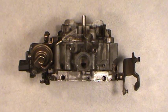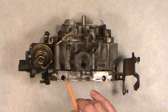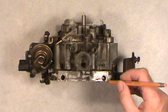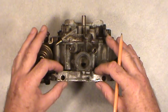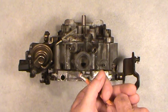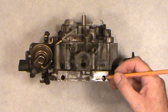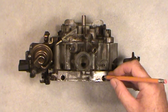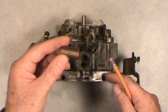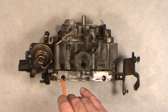So what I did is I got out my high-speed electric grinder, also known as a Dremel, and put a little grindstone on there. Like you see here, there are holes here now — these were solidly capped with the hardened steel plug I was telling you about. So I just took my time, put my safety glasses on, and went to it. I had the carburetor apart — just the throttle body in a vise — to steady it up with two hands on the die grinder. I just kept grinding around on the end cap and kept grinding until I actually broke through and removed the end part of that cap. The steel shell is still in the throttle body itself — that's how I got to the idle mixture screws.